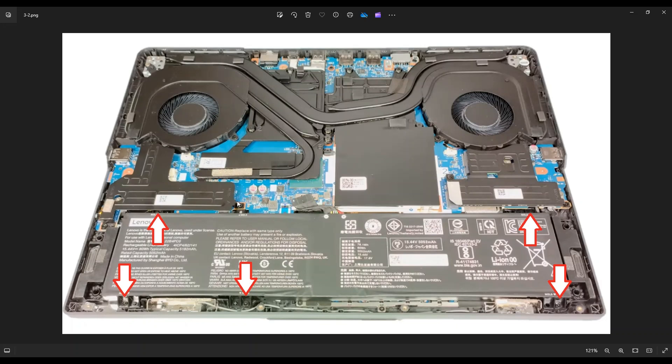There are three screws in the SSD shield: one here on the right, one down bottom left, and one up near the fan. Once you get that shield off, you'll be able to access that hidden screw. After taking the screws out of your battery, there's the battery plug right here. Some of you may see a black piece of tape on it — just peel that back and wiggle that out of the port. Try not to pull on the wires; just manipulate the plug using your fingernails on either side or a pry tool.